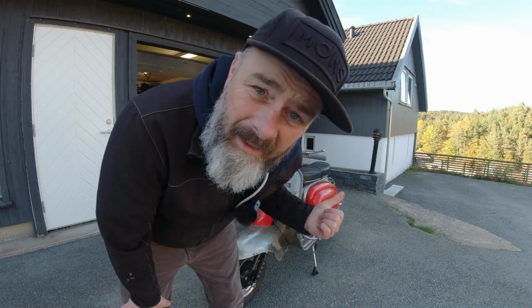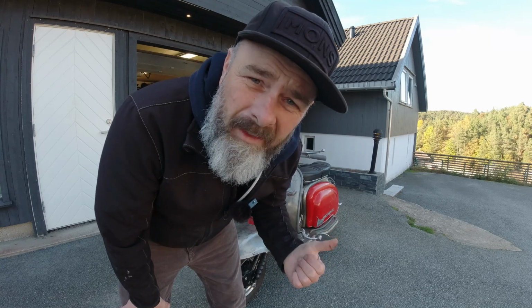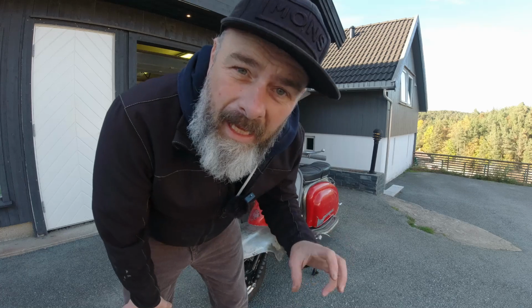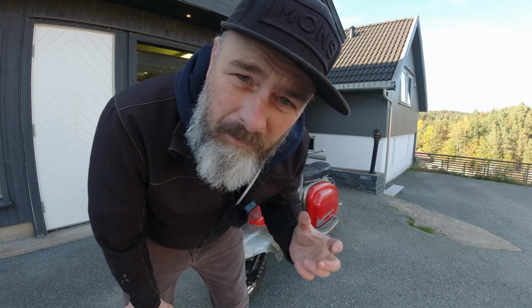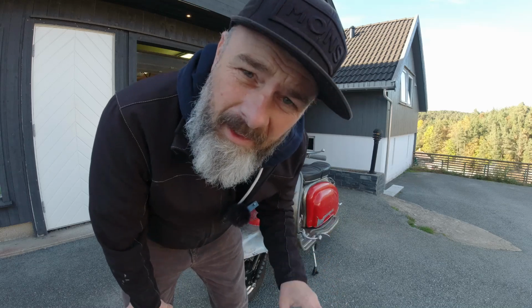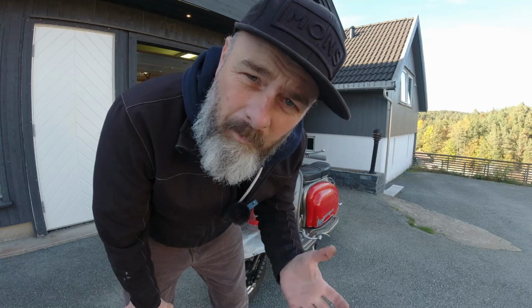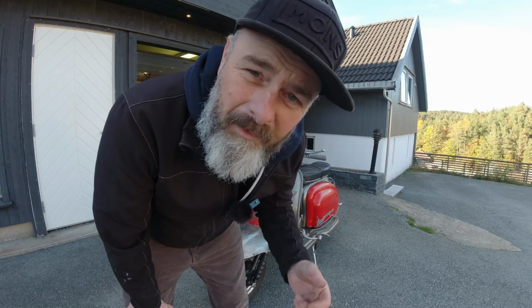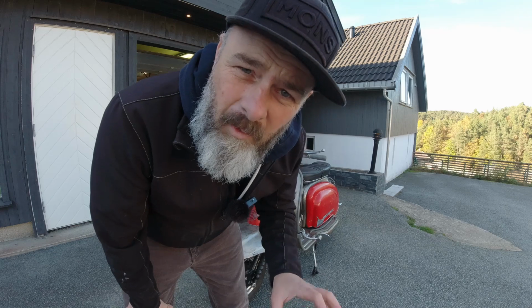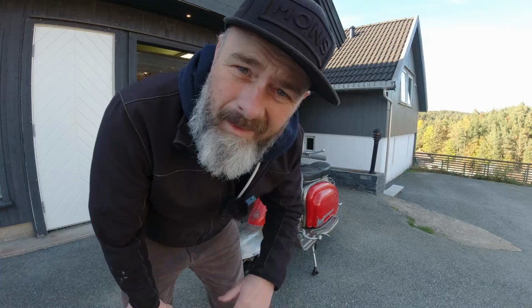So unfortunately, I just started emptying the gearbox oil, and the gearbox oil is really aerated. And this is brand new gearbox oil that I put in last week, and it smells like petrol. So it's definitely a no-brainer, but I'll start it up anyway, and you can see if it clears up and can rev. I obviously don't want to do that too long without the gearbox oil, but it's just so that you know 100% before you start stripping the engine that that's what's wrong with it.